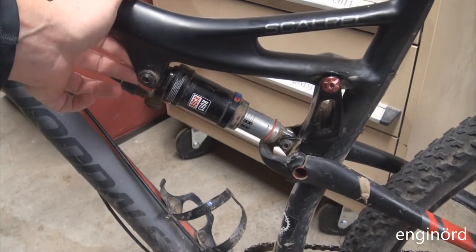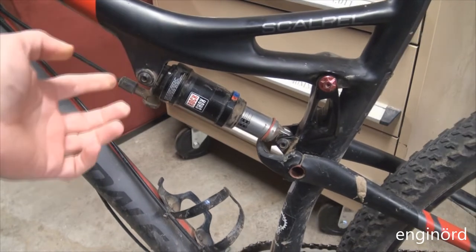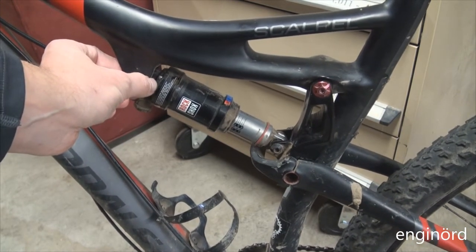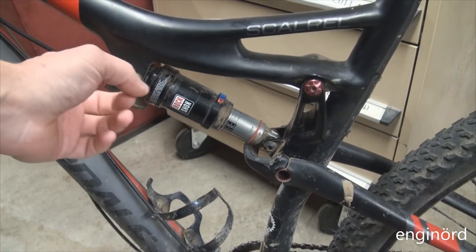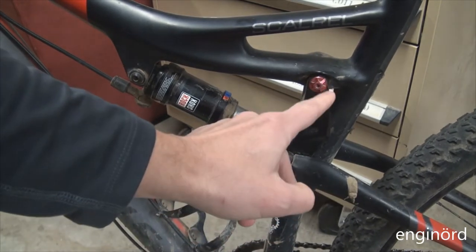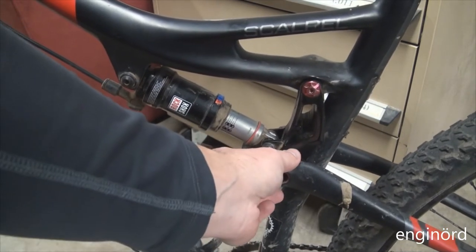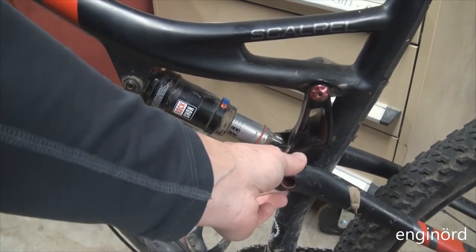So I am lifting up the saddle with one of my hands, and I'm using my other hand to sense it. In this case, I'm lifting up the saddle and I feel the clicking with the saddle, but there is no relative motion in this joint. Same here, I can touch this bracket and the swing arm, have my fingers on both of them, and when I lift it up, I can feel that they are moving together.